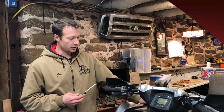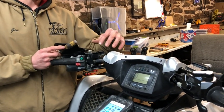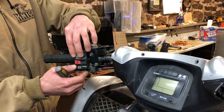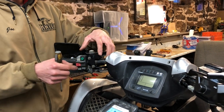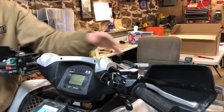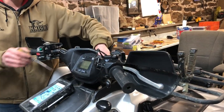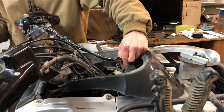The first step is to remove your controller and anything else that's in the way of unplugging it. Underneath, most of them have two screws — remove those and your controller will open up and come off the handlebars. These screws will allow the entire brake lever to come off. There are also screws that take the plastic piece off, and then three screws that hold another plastic piece in. Take those three screws out so you can get down to the bottom of the wire harness.